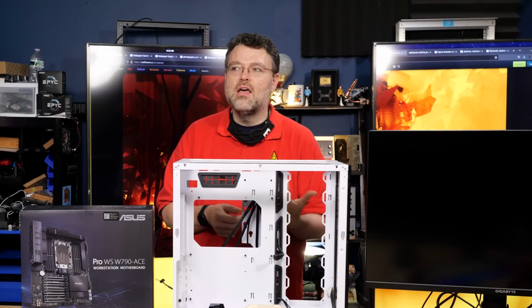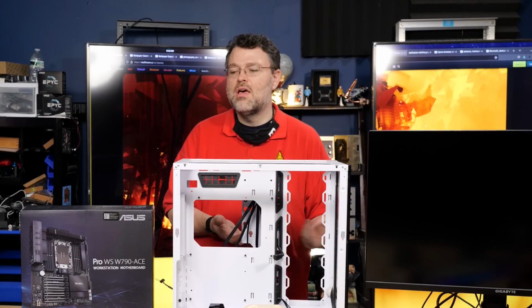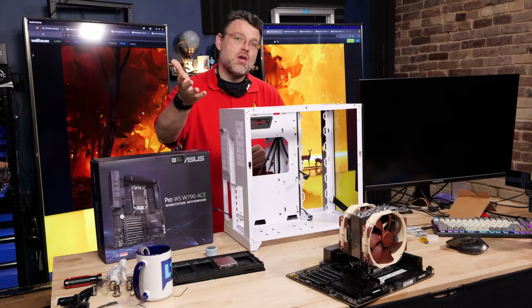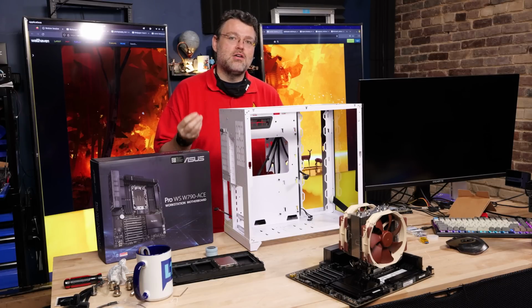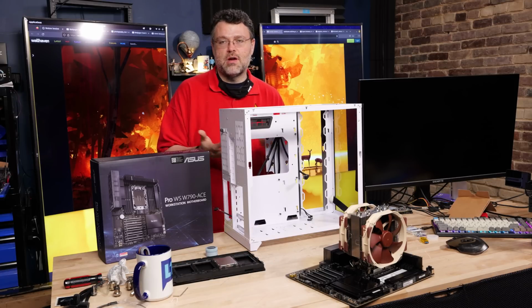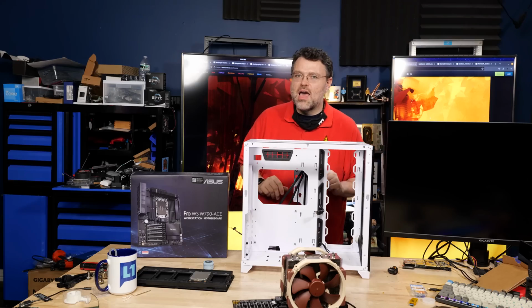This is good quality silicon, and yeah, when you do that at 16 cores, it's going to use about 45 watts per core, which is not a lot different than the desktop parts, but still, that tells you how much headroom there is with Sapphire Rapids, and maybe how much performance you'll get out of the core, assuming that a die shrink or a process shrink will bring you a little bit more power efficiency for the silicon, because the performance would probably stay about the same. The clock speeds generally don't improve anymore with the shrink, but I'm getting ahead of myself.